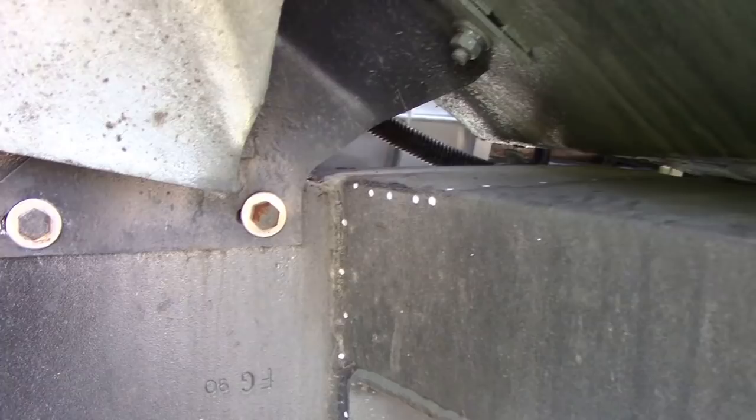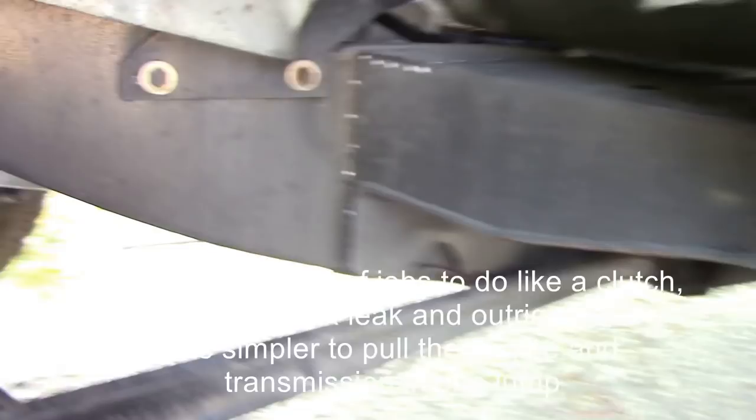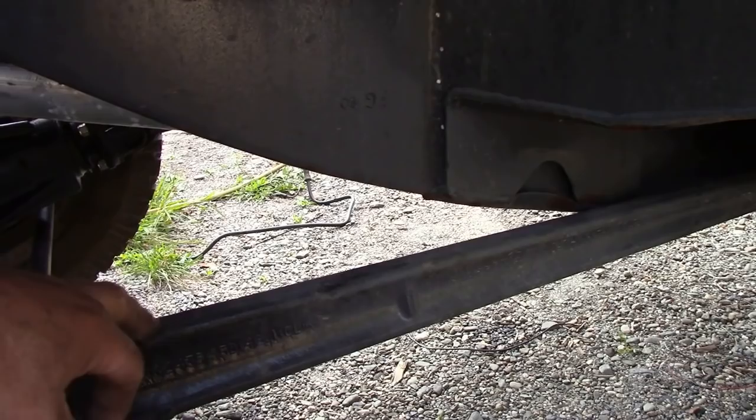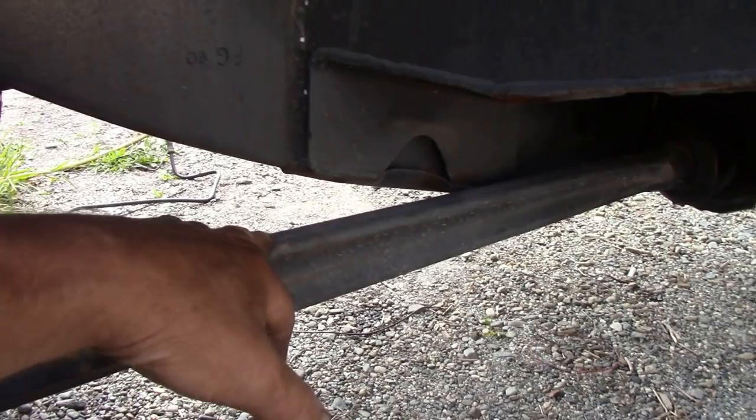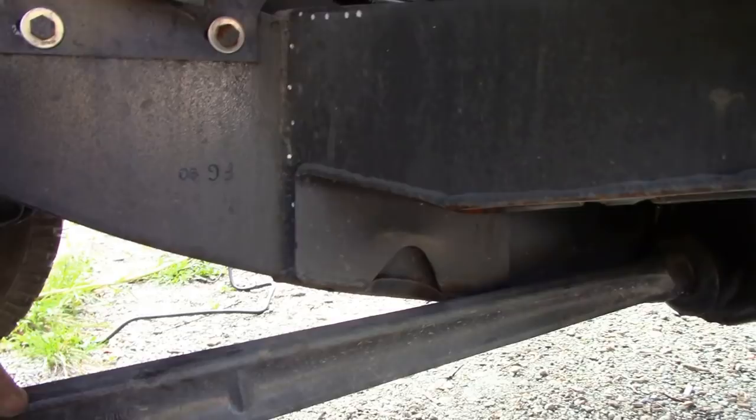The other thing I wanted to tell you is I take off the radius arm. Now this is dropped down, and you can't quite get into that bottom corner. So by taking the radius arm off, you will be able to get into this, and there's loads and loads of room to work. It's easy - there's no point making work for yourself and no point struggling.